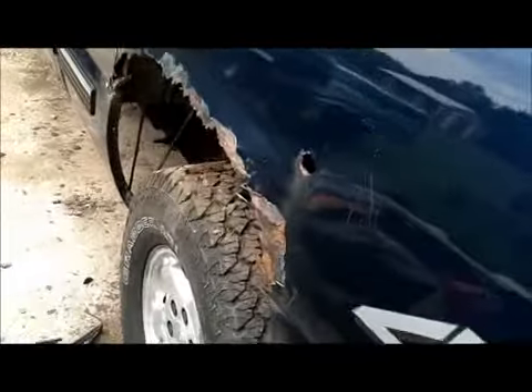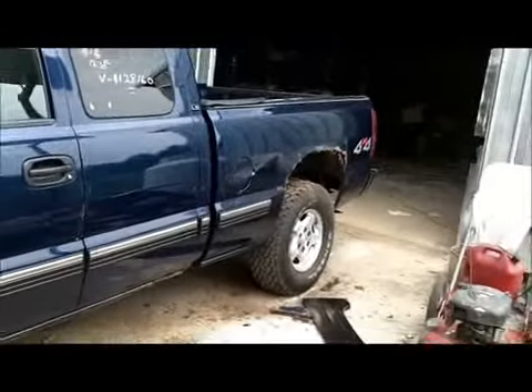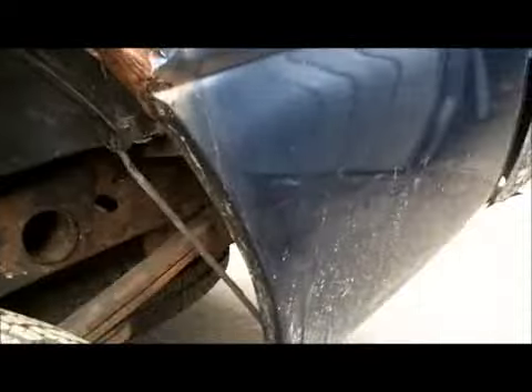You guys can see this truck go from a $2,500 truck to a $6,000 truck. The first step is what you guys want to do is actually cut out this rot. I've already started cutting this all out with a cutoff wheel. I'm not cutting out the whole area of the panel — it's going to overlap quite a bit — but you at least want to get a majority of this rot cut out of here, otherwise the rot's just going to keep going up and up and up. You don't want that, so let's finish cutting out this area here.